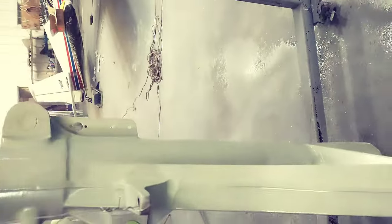So today we are painting the landing gears on an aircraft. What you want to go ahead and do is strip it to bare metal, and after that you want to go ahead and scuff it. And after that, we go ahead and use Alodine and an etch to wash it to give the best results. And then use epoxy primer, as I'm doing right here.